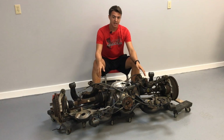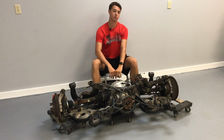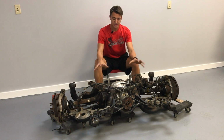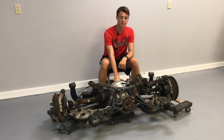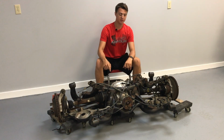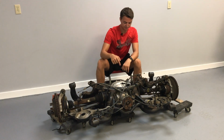I bought this and the cylinder heads and the valve covers off of that 03 Cobra for 1200 bucks. So these things come with a 355 rear axle ratio, and they come with 31 spline axles, and they come with the Ford hard launch brace.